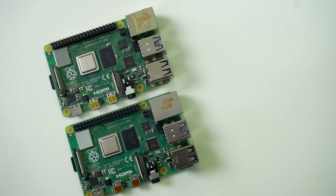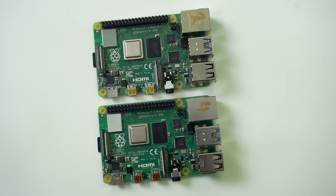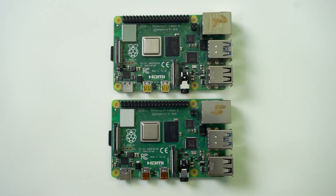One of the great new options is that you can pick boards with different amounts of RAM. Up until now, we only ever had up to one gigabyte maximum. One gigabyte is fine for command line or very simple desktop tasks, but it doesn't take long opening a couple of browser tabs or LibreOffice before that RAM gets consumed. Now there's a one gigabyte version still at $35 — or £35 in the UK — plus a two gigabyte version and a four gigabyte version.